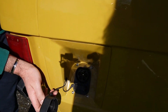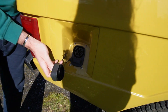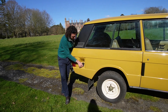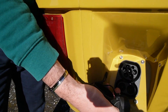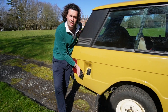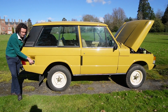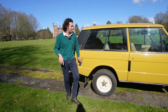Toby, our engineer, made this charging setup and we're very pleased with it. That's the Type 2 socket - normal charging on a lamp post, your three-pin socket at home, or any socket. Then coming in here, that's DC charging - your super-fast charging. Those two terminals are directly connected to the plus and minus of the battery, so you shouldn't lick your fingers and touch them - though with the HV system off right now, it's fine.